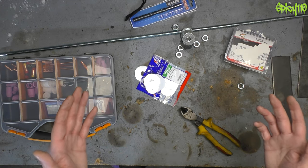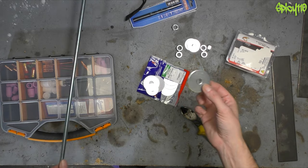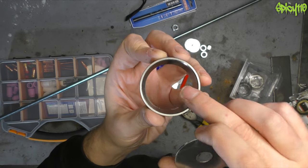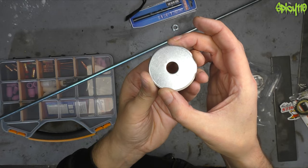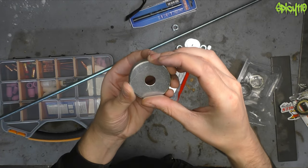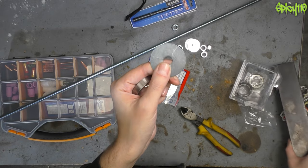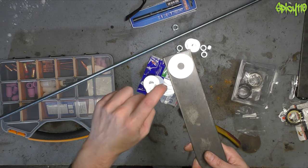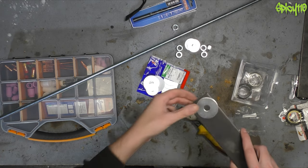So in this video I'm going to make that tool. I've got decent quality all-thread which is M12, some M12 nuts, and some washers. This 50mm washer is very close - this is the race that needs to be pushed into the bike frame. There are two of them, top and bottom, and as you can see it's tapered so it's thicker at the bottom. This washer does go over that edge just about right, but it's a cheap washer and when I try to pull the race in it's more likely to just bowl inward. So I'm going to make bigger versions of this using some steel plate - four and a half mil thick, so that's going to be pretty strong. I need to make slightly bigger versions out of this plate, TIG a nut on the end of the rod, cut it down, and that's basically it.